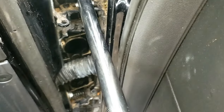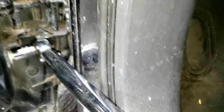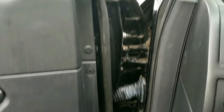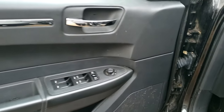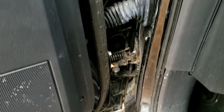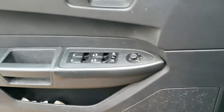Torque all the bolts to 21 foot-pounds. Hopefully this video helped you — if so, please like and subscribe. In summary, taking the door off was not hard. Keep in mind it's heavy, so be safe and make sure you have all the tools mentioned in the description below. This should take no more than 45 minutes. Let me know your thoughts in the comments or if you have any questions about this door or would like to mention something to other viewers.